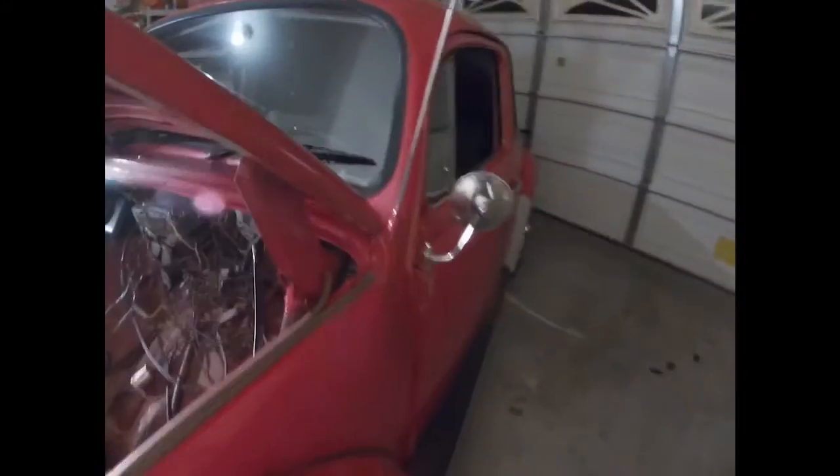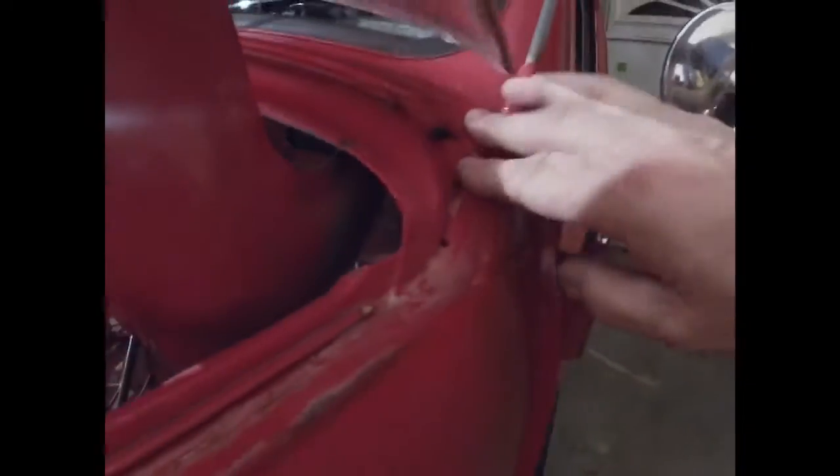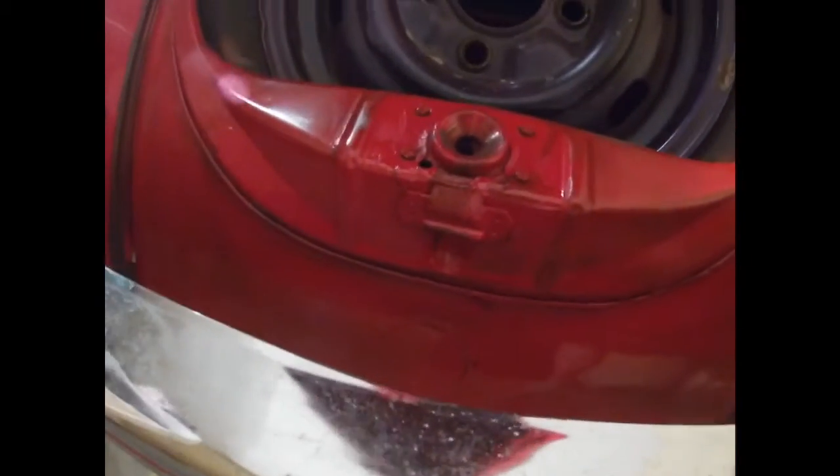Starting on the bonnet hood — I had tried just some weather stripping just to seal it up for a couple days while we were driving. Didn't really do much, but I didn't really expect it to. We'll get this stuff off. We've got three little holes right here, and there's little nipples that go in to kind of hold everything in place — we've gotta get those cleaned out, make sure our channel's clean. It'll come down and around, and I believe it's going to kind of seal up down here underneath the hood release.